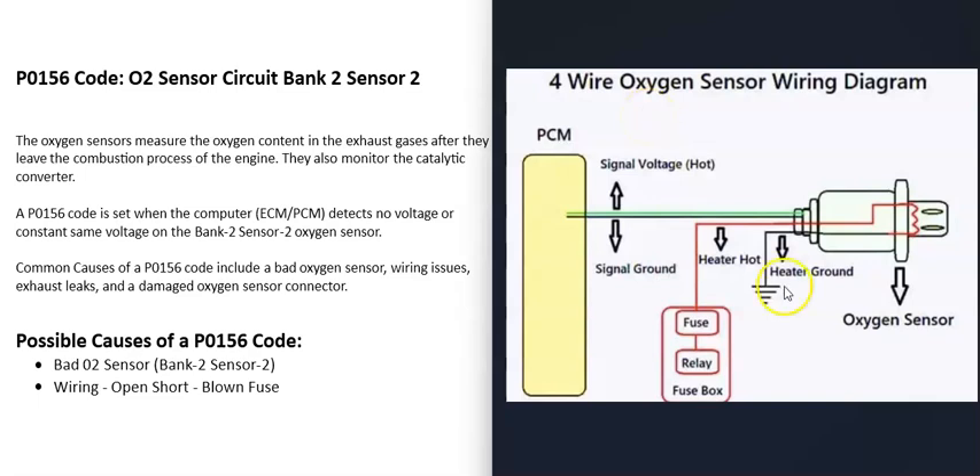These four-wire sensors are fairly common. O2 sensors have two parts: the oxygen sensor portion that detects oxygen in the exhaust, and a built-in heater element. The oxygen sensor can't get good readings until it heats up, so heater elements were built in to warm it up quickly rather than waiting for the engine and exhaust to warm up. These heater elements usually have 12 volts going to them — be sure to get a diagram for your specific vehicle.